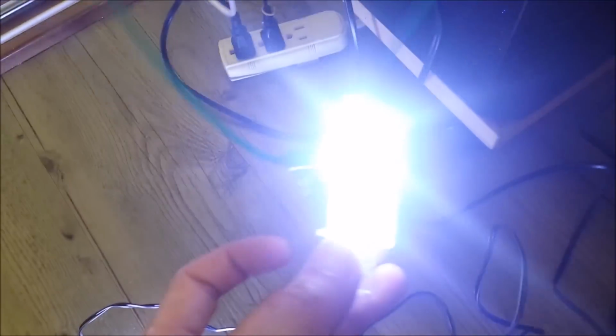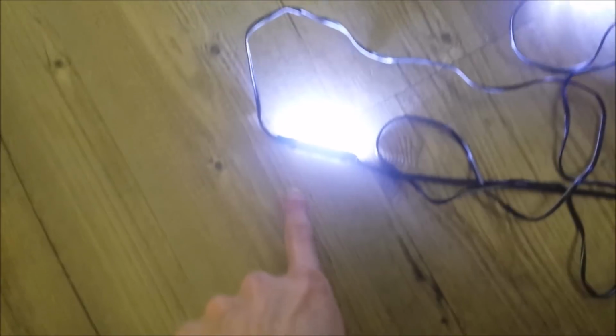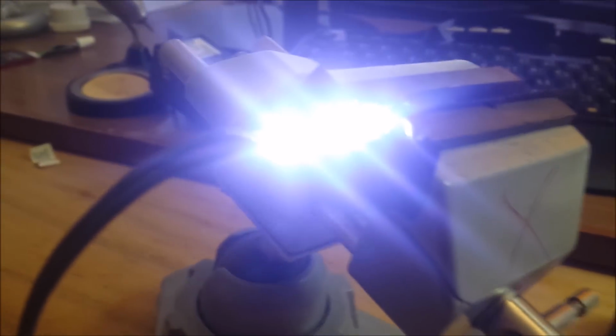Went ahead and soldered the second LED on, and so this is the result. This is the left front footwell light. Wired it up to, this is the left rear footwell light, and all the way up here, this is the last one, the rear right footwell light. And let me put the heat shrink on, and I'll go downstairs and show you how to put it on. Oh, also, just make sure you remember when you solder the third one, you still have to make sure the polarity is right.